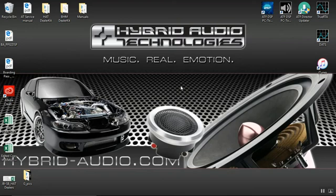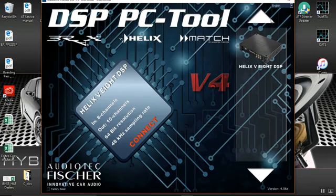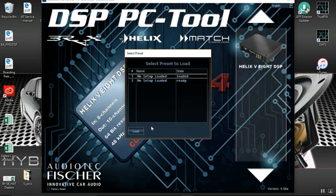Just a quick video on this, so let's go ahead. We've already got the DSP hooked up and powered up. If this is your first time, make sure that you plug in the USB first before starting the software — you'll usually hear a chime from the computer letting you know a new device has been plugged in. Once that happens, we can click on the version 4 software. It looks a little different than the 3.4, but we're already set up and it's going to say 'connect.' If it's not seeing it, it'll say 'start demo,' but we're using the V8 DSP today and we're going to connect and set up our inputs and outputs.